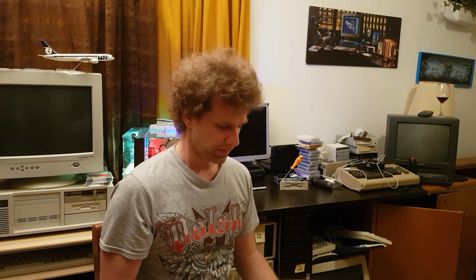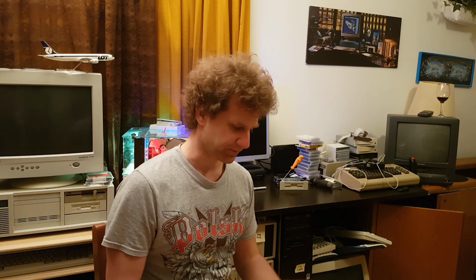So where are we now? I've made some notes. I've decided to keep the 1.44 meg drive in there. There are some interesting challenges along the way, namely that the BIOS didn't natively support a 3.5 inch format at all. So you may be wondering, how can that be? We saw you put the correct parameters into gsetup. What's up with that? What I'm thinking is happening here is that the G in gsetup stands for generic, not particularly attributed to any one particular drive.